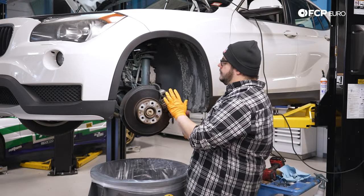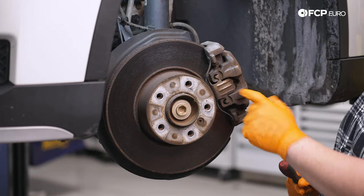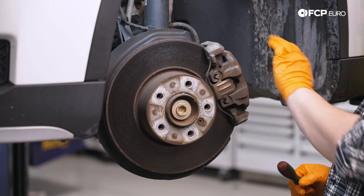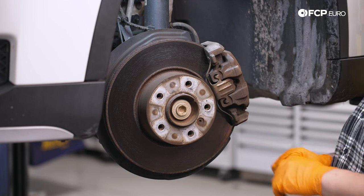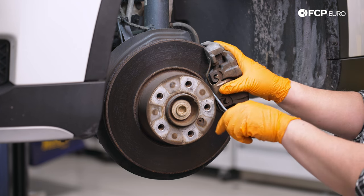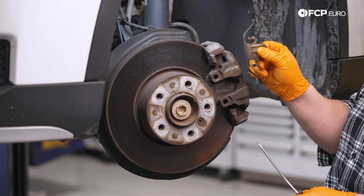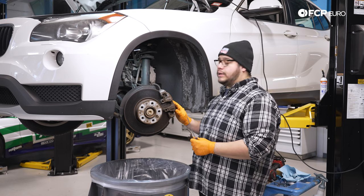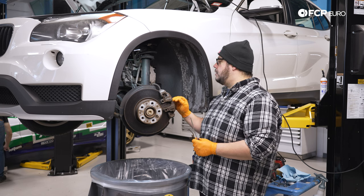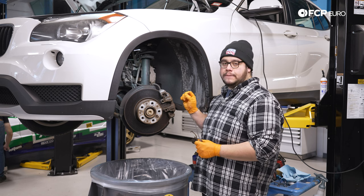With the set screw broken free, the next step is removing the anti-rattle clip. Simply push from the center and push upward toward the outside of the caliper to unhook the two small tabs. I like to use a small flathead screwdriver, and keep one finger over the clip so it doesn't spring into your face. With that off, we're now going to work on removing the brake pad wear sensor and get our new one routed so that when we're done with the brake job all we have to do is clip it in at the end.